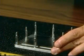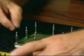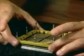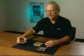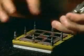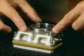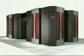I'd like to now assemble the different technologies to demonstrate how this gets assembled into the module. We have a backer plate that goes on the back of the PC board, because the 350 pounds of force would otherwise push the MCM through the board. The compliant interconnect is permanently mounted to the PC board, then the MCM, which comes pre-packaged and sealed from the vendor, is placed onto the compliant interconnect. The 350 pounds of force is applied, and springs and C-clamps are installed to hold everything in place.